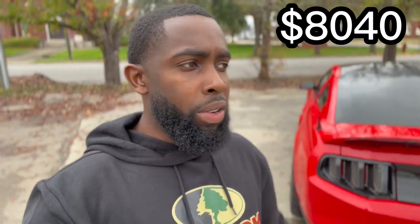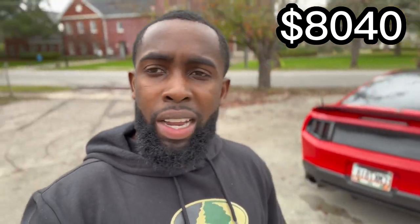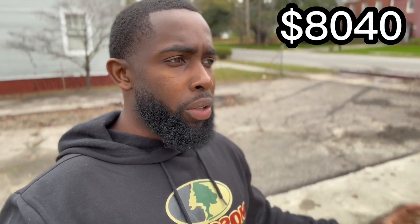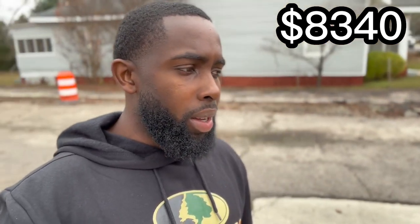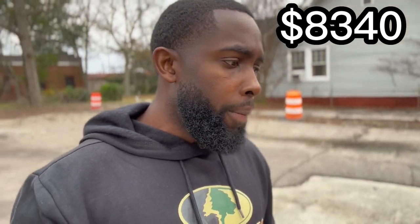With that setup, you can be looking at, with the long tube headers, I got them from Speed Daddy off eBay. Those were $300. I couldn't really show them to you because it's deep down in the engine bay. I think with this full setup, you should be running around between 420, 430 at the wheel. That's a good upgrade from like 390, 395 stock. And there are other parts that I couldn't show you because they're under the car, of course.